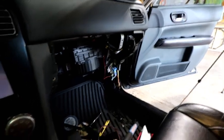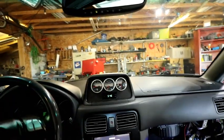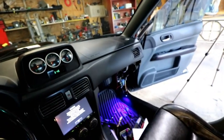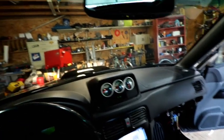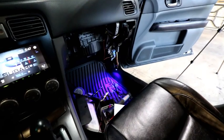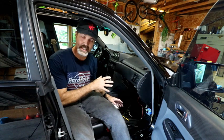You can see the light is not working, but the second I put it in gear, that blue light comes on. Now if I turn my headlights on, you can see the headlights came on and that test light goes off. Also, it doesn't affect my regular lights. If I pull the parking brake it goes off, and putting it back in park turns it off — so it will function without interfering with how the headlights work.